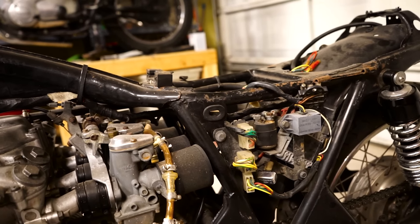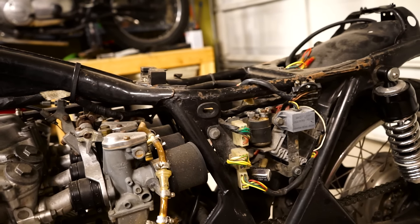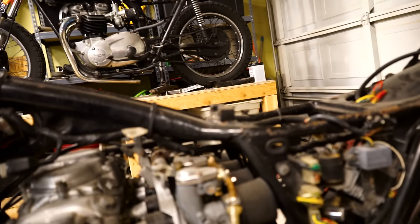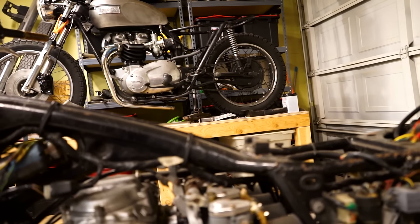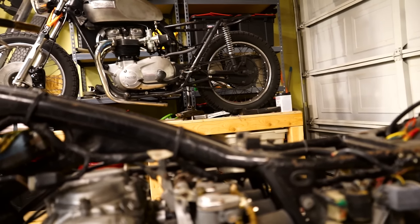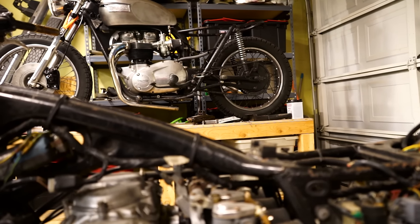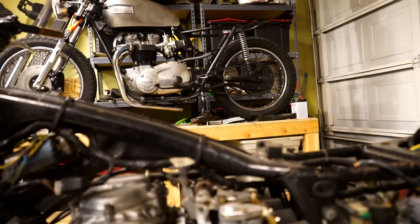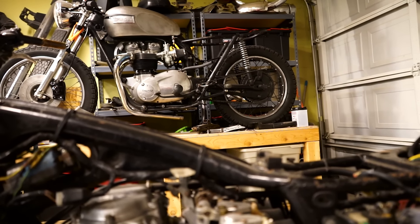Since it's a gel cell it doesn't have fluid in it, so you can mount it sideways or however you want. I'm probably going to build a very similar battery box in this bike. For the Triumph I think I'm going to go with an anti-gravity battery because I really want to hide that battery - the anti-gravities are really nice and small but they are expensive. I need to look up if there's any issues running an anti-gravity on a Triumph because I know the wiring is weird - I think it's positive earth, a little backwards from normal bike wiring.